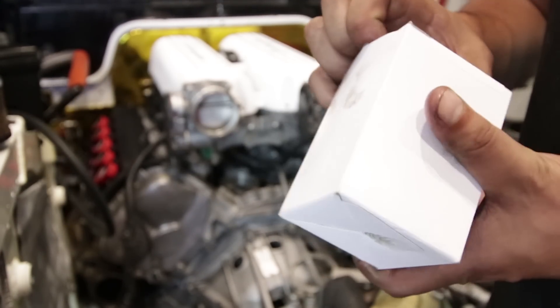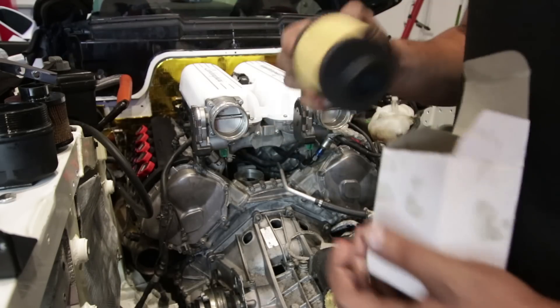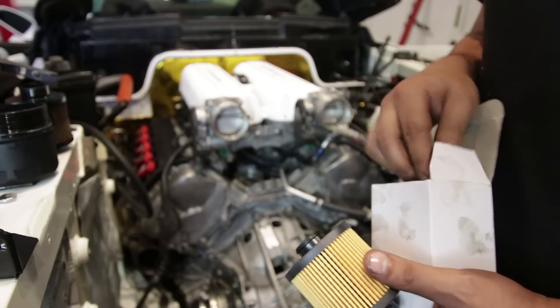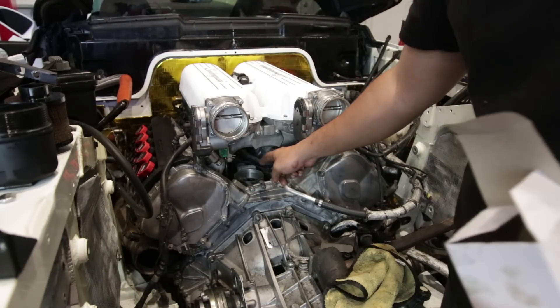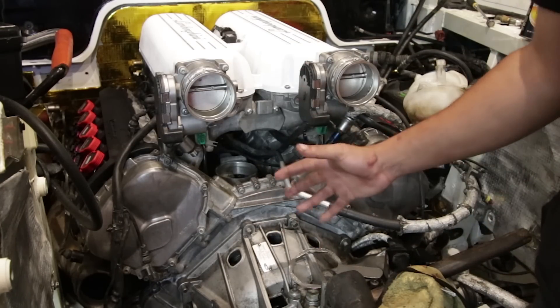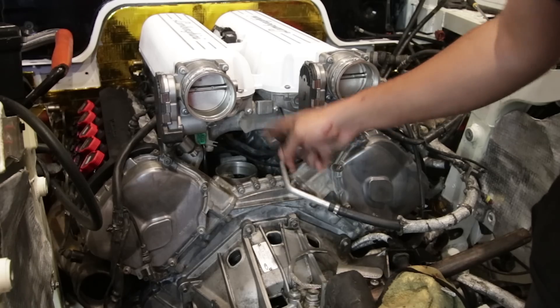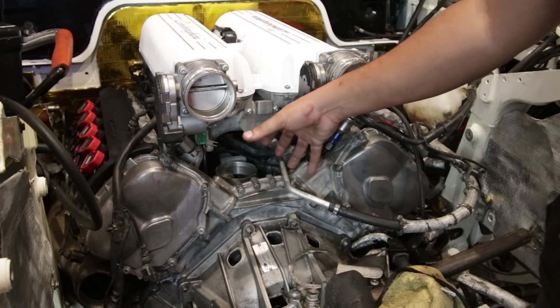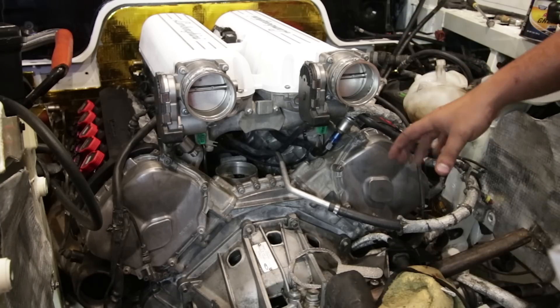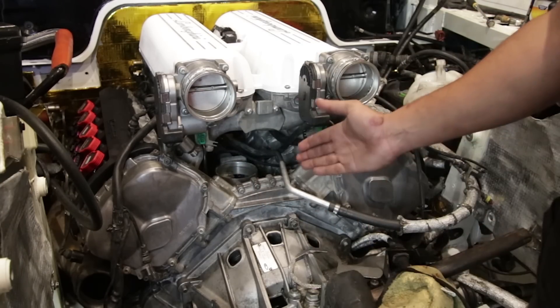I'm going to clean this up. Here is our new filter — it's made in China and is identical to the one we took out. I'm just going to slot this in, put the new O-ring in, and clean everything up because it's a little dirty in there. If anyone knows of a kit that would remote-mount the oil filter somewhere else, I'd be really interested. I'm not sure if this uses an Audi thread or something, but I'd love to find a kit for an 08 Gallardo with a 5.0 that lets me mount it somewhere easier, so I'm not running this specialized almost $100 piece.